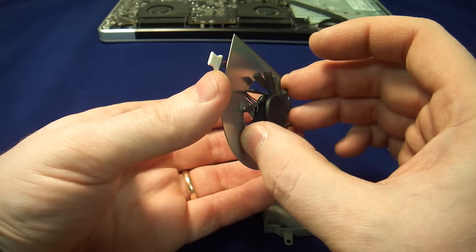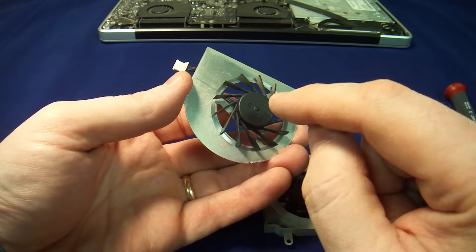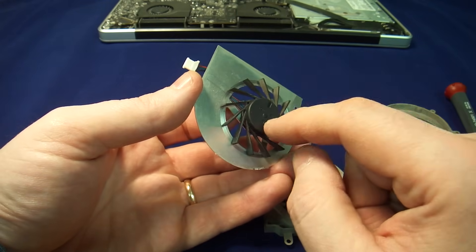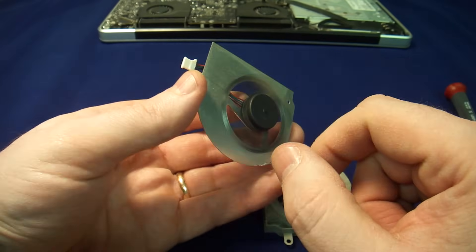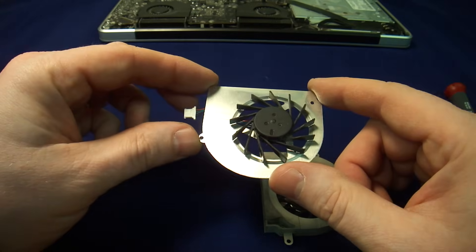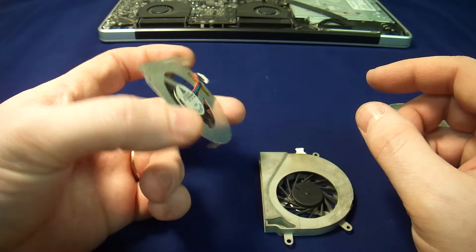Don't quote me — not all problems are the same. I see this a lot and it is fixable and workable. But beware, this would be fixed for about a month. If you want it to last longer, you need a proper lubricant — and you're probably not going to find it. I haven't found one that was good enough to last longer than a month. So, one of two things: you either save money and keep putting drops of lubricant in — for that you have to take your computer apart, but often times it's fairly easy — or go ahead and find yourself a new fan.